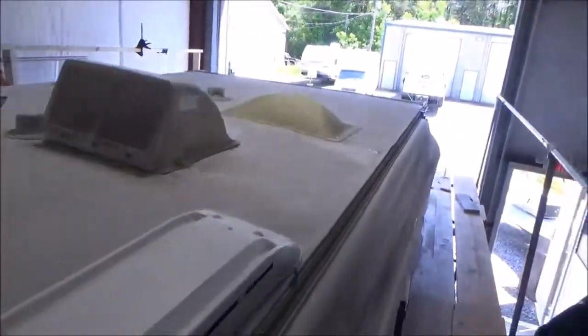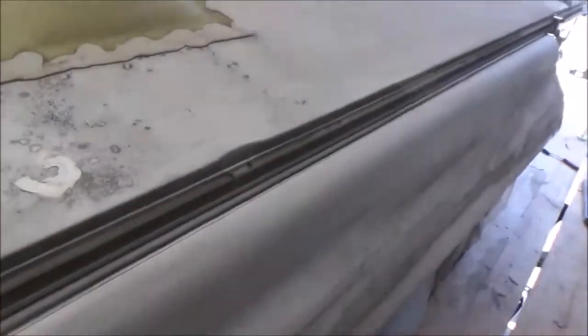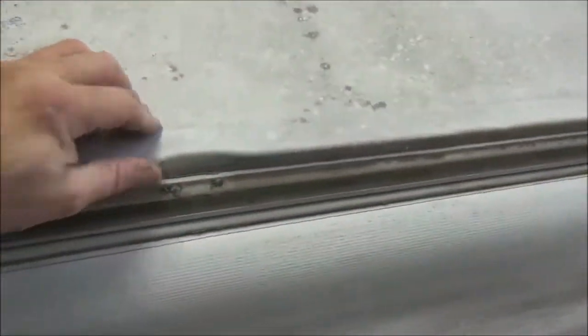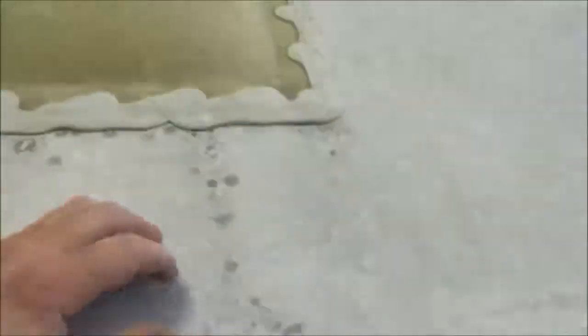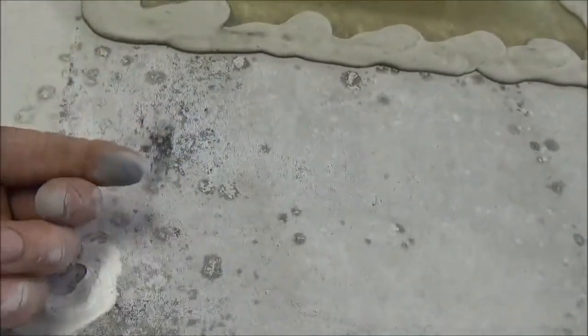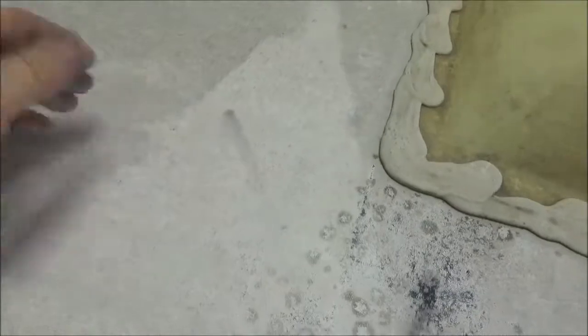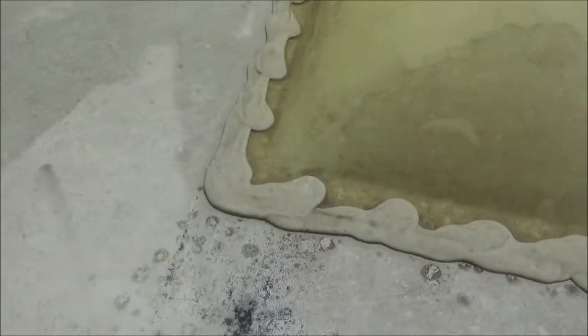Kind of give you an overview — this is where the awning went. You can see some of this deterioration here; it's starting to fail. That's what happens with rubber. That's why it's hard to put a coating on these — you've got to clean all this off to try to get a coating on it, because it's not going to stick.